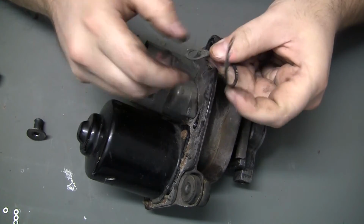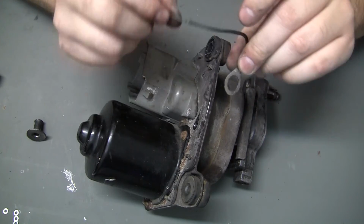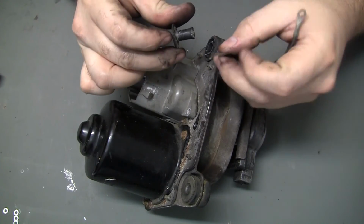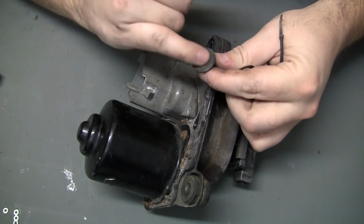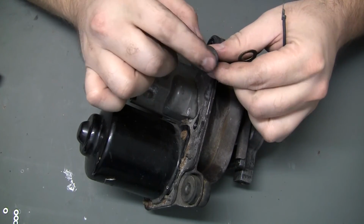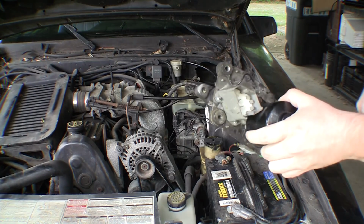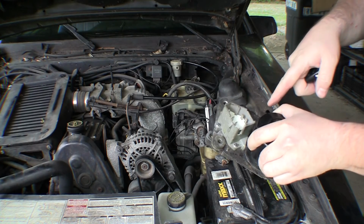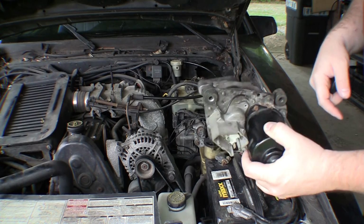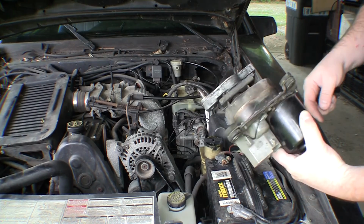Yes, I guess it's not that bad. Worth a cleaning though. That side too. That part just slips out. So it's probably making ground contact on the bolt right about there, so I might want to sand that a little bit too. What I'm going to try to do is just plug it in, and first make sure that it's going to seat all the way down in there and be okay. And then also to operate it before I connect it to the wipers, just because it'll be easier to look, make sure it's working alright.